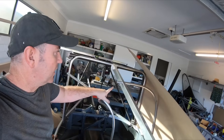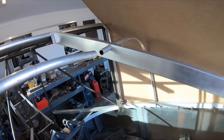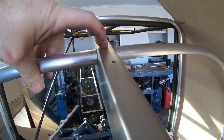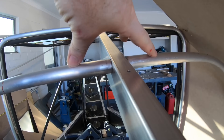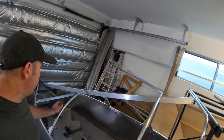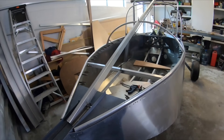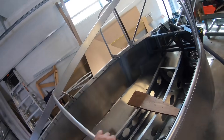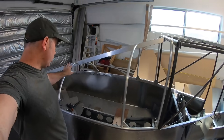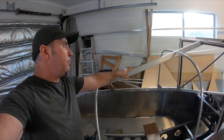A nice simple easy way to mount these tubes - I've put a hole through the beam here. I've got one slightly smaller that slides in, fixed through here with rivets and through the centre, and that tube will reinforce the internals between the two. I've just finished the curves on these tubes and mounted them on - gives support for the actual windscreen. This section between here is the door, just going to flip up that way, so it's hinged off here, which is why I've got such a solid beam going all the way through.